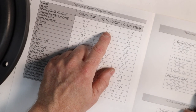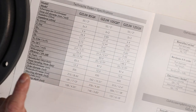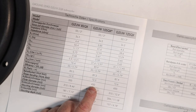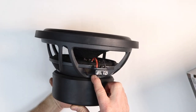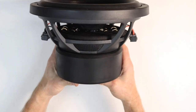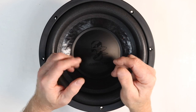Let's go back and look at some of those specs. Voice coil diameter is 2 inches. This is a dual 2-ohm driver. FS is 41.6 Hz. Efficiency is 87.2 dB. Outer diameter is 10.3 inches, mounting diameter is 9.29 inches, and depth is 5.83 inches. Power handling is 450 watts. The cone is pressed and coated paper, it has a Kapton voice coil and former, the surround is foam, and it has a removable screw-cover gasket made of rubber. Looking at the side, there's a mesh grille — the voice coil feels really nice and really well built. I can't wait to get it into the car and start listening.